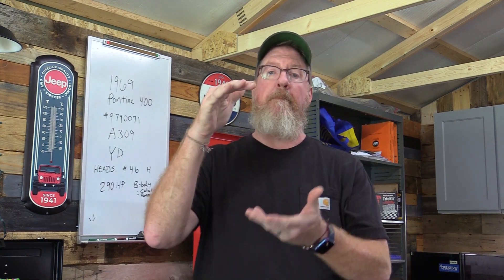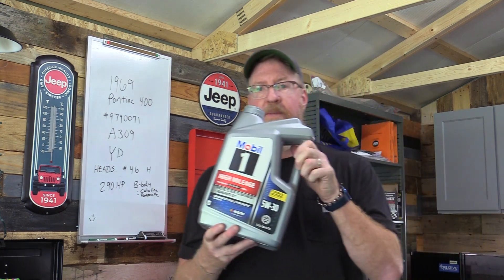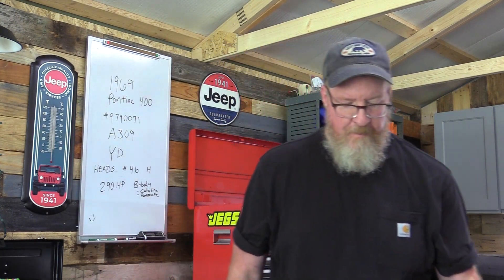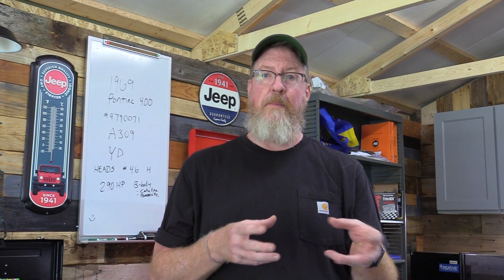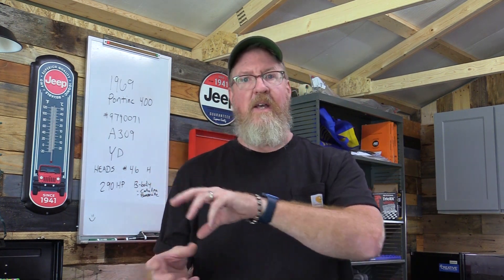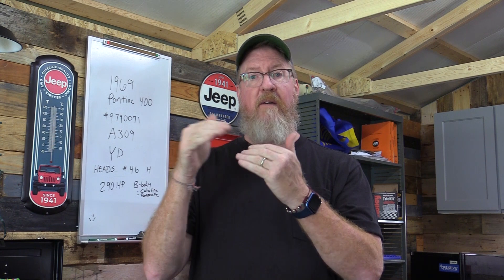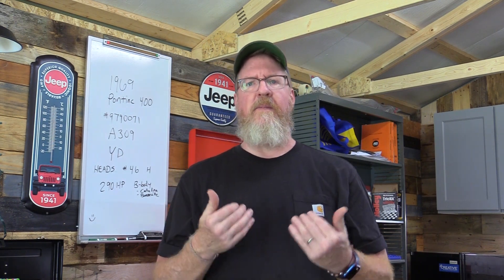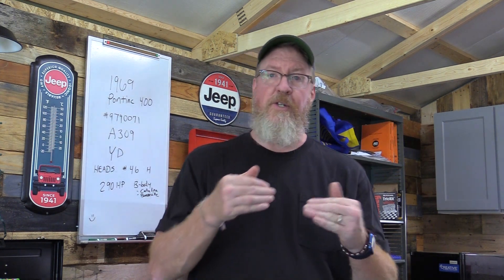Make sure you find out how much oil you need. Some cars take three quarts, some take six or seven. Most average about five quarts, but check — you may need to buy an extra quart if your car requires six. Also make sure you don't overfill. Some people think more is better, but too much oil causes it to froth up and cause problems. The more oil you have, the more it actually interferes. Make sure you put in exactly the right amount — don't overfill.